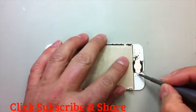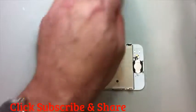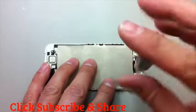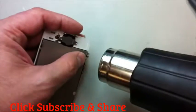And on the inside, you'll see we have two screws that hold this metallic plate behind the button, and then you also will have adhesive underneath those gold connectors. So once these two screws come out, don't go too far ahead. You want to make sure that you do release that flex cable from the glass, the frame rather, because if you don't, you will tear it.